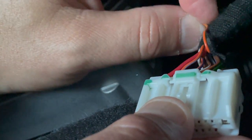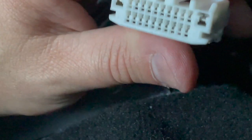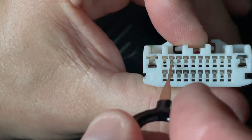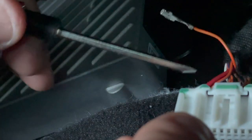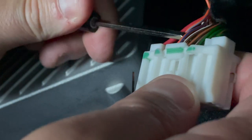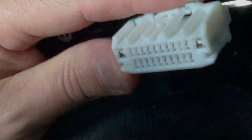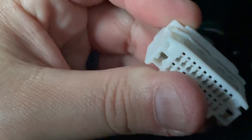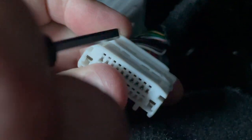Pull this one out and put it off to the side. Let's repeat the process. Slide it right in — here's the little hole, slide it in right above that. Put the tweaker to apply pressure on the wire. By the way, while you're handling this piece, you may squeeze it and in doing so you may re-lock this connector. See how half of it's closed? I've already started to re-lock the connector from squeezing it, so go back and make sure the entire locking mechanism is open.